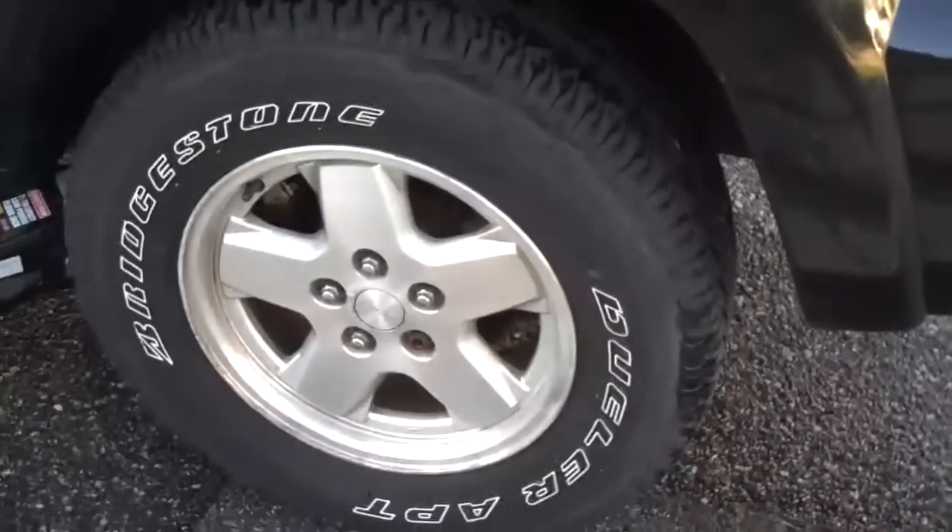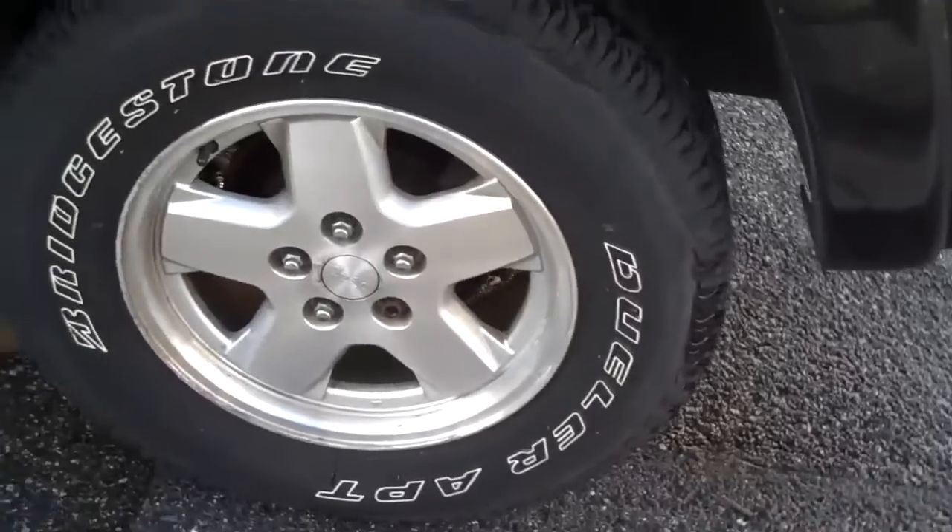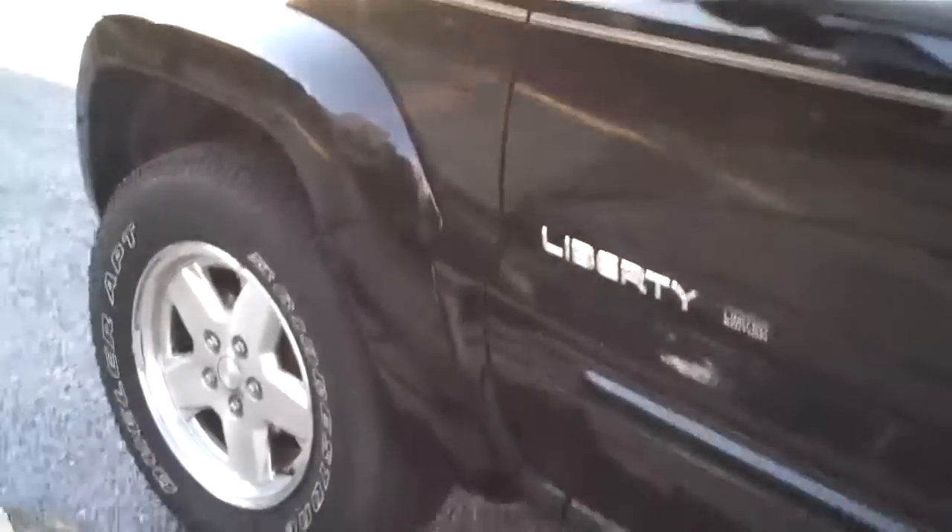The pattern for this is that rear tires go to the front, and the front tires crisscross into the rear. So driver's side rear is going to go to driver's side front, driver's side front is going to go to passenger rear, passenger rear will go to the front, and passenger front will go to the rear.